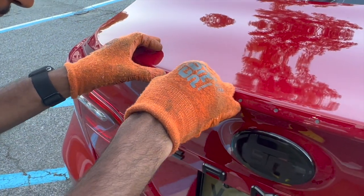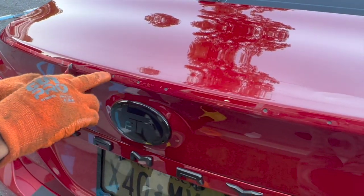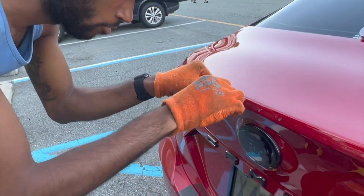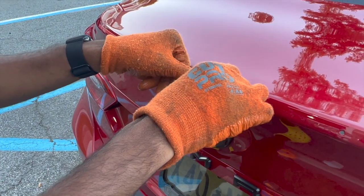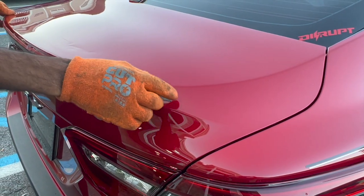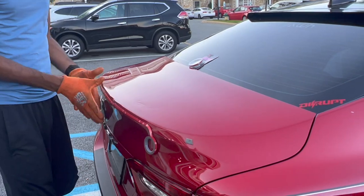Just don't want to have any problems. If you look real closely, the holes aren't see-through — I also have 3M tape on the inside of the trunk so there are no water issues. I had it like this for a whole year and never had a problem. The holes over here are bigger, so I recommend using the 0.5-inch tape on those, or just use 0.5 all across to make sure it covers the hole.